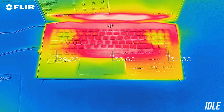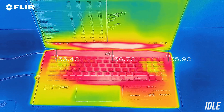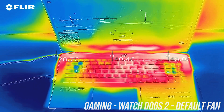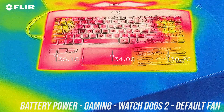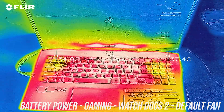As for the external temperatures where you'll actually be putting your hands, at idle it got to the mid-30s in the center, about average. While gaming it was in the low 40s, while the WASD keys were quite cool comparatively, then slightly cooler under stress tests. While gaming on battery power, the wrist rest area got hotter than before, with the hotspot on the left exactly where the battery is located.